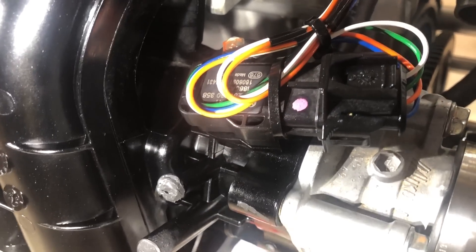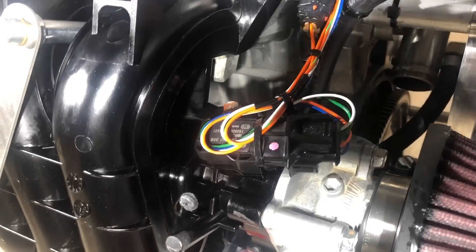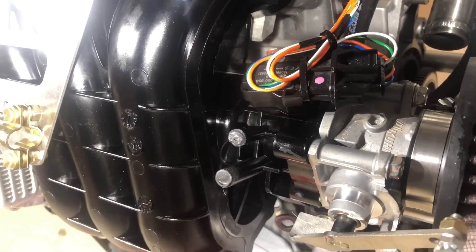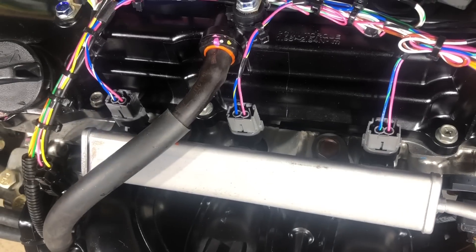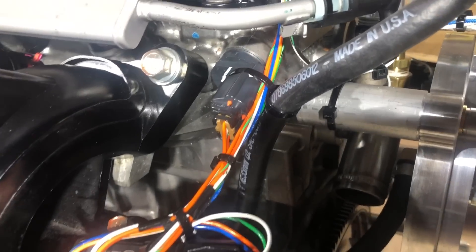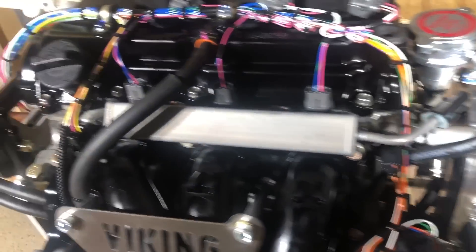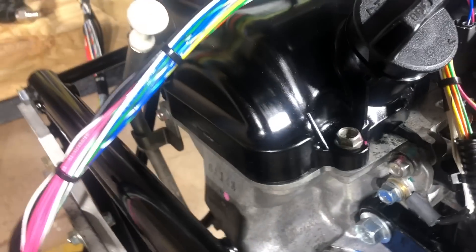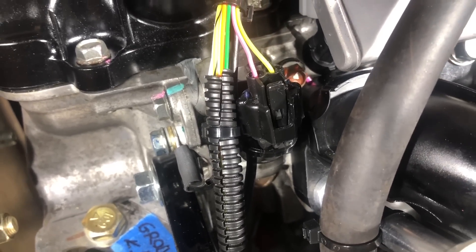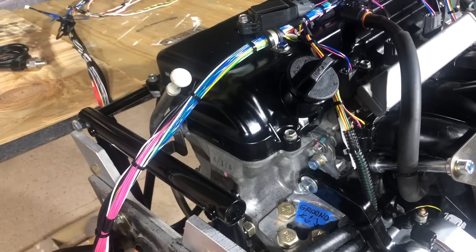This part is the MAP sensor — the manifold air pressure sensor — a very vital part of these modern fuel-injected engines. It senses the temperature and pressure of the air entering the intake manifold and thereby computes the amount of fuel needed, no matter what altitude or temperature the engine is being flown at. You also see the cam angle sensor, which works in conjunction with the sprocket on the back of the intake camshaft and the variable valve timing solenoid, working together to make the engine idle smoothly and produce maximum horsepower and torque at maximum power.